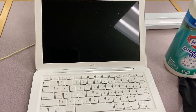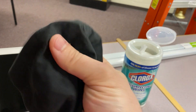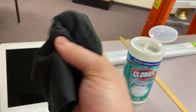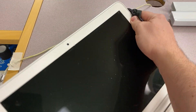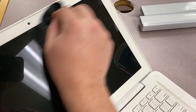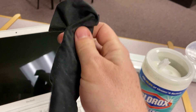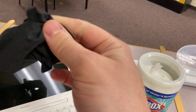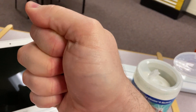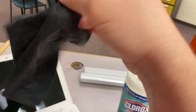Once you've got it all cleaned off, you're good. Now, how do we clean the screen? Get yourself a soft cloth — this is a micro suede cloth, some people call it microfiber. This is what you use to clean your eyeglasses. Just go ahead and wipe the screen down with that soft cloth. The eyeglass cleaner actually does a really, really good job. If you want, you can get the cloth a little damp — run it under water. Don't use Windex, don't use other cleaners, just run it under water. Wring it out really well, just like I did with the sanitizer wipe, wipe it off, then go with another soft micro suede cloth and dry it off, otherwise you'll get water spots.